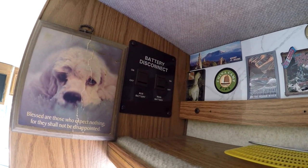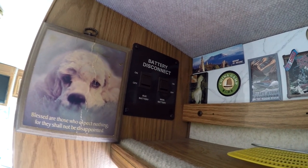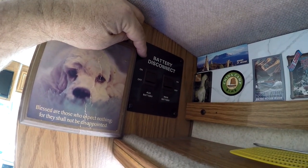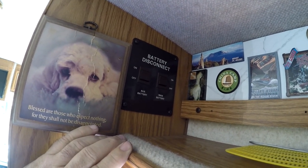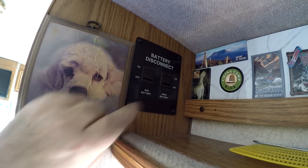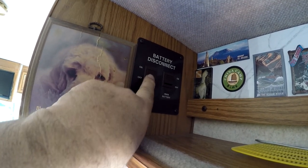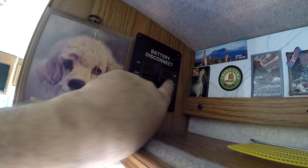Always when working on any kind of electronics in your motorhome, the easiest way to disconnect all the power is to use your battery disconnect. All motorhomes have these on them — the newer ones as well as older ones including this 1994. You simply press this one for the auxiliary battery to turn it off, and then the main battery you also press as well.